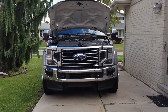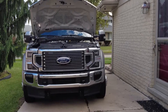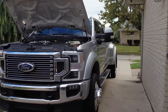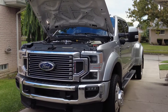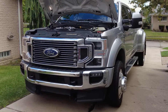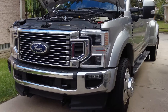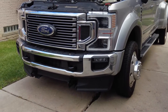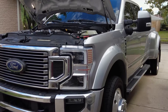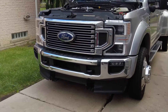If you're an over-the-road trucker or hotshot guy, you don't even need to think about OCR because your truck's always hot and it's always going to get into passive regen — it's not going to be an issue. But for guys like me who daily drive one of these trucks, you've got to understand Operator Regen. Those are some key points for first-time diesel owners or guys who are new to Ford diesel trucks. A lot of this stuff crosses brands — a lot of this applies to your Cummins and to your Duramax.